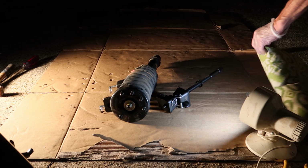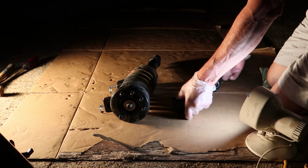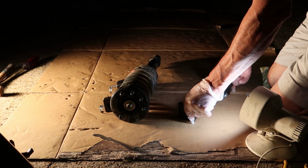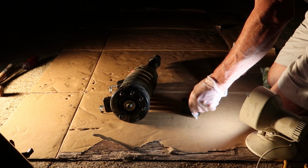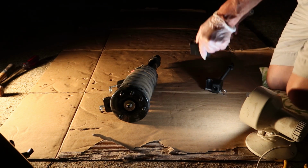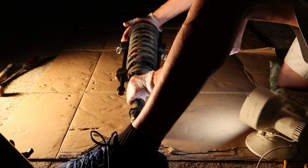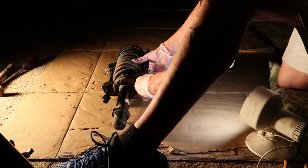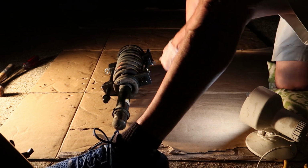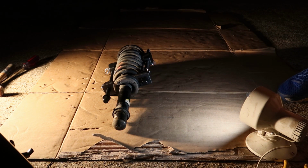Okay, now that we've got our strut out of the wheel well, we can go ahead and compress the springs to remove the shock and replace that. I actually bought my own spring compressors, and I'll leave a link below from Amazon. You can get a pretty good deal, or you can rent them from O'Reilly's or AutoZone and get your money back when you're all done with them. Just make sure that when you place these spring compressors on, they're spaced evenly across from each other. It'll compress much better if you have a nice even spacing on there.